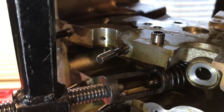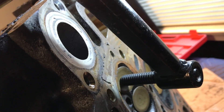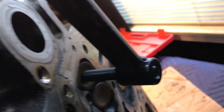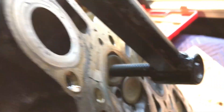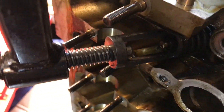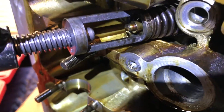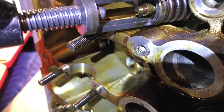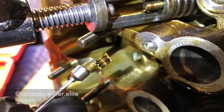You don't have to worry about trying to unload the spring so the keepers pop out. The bottom part centers perfectly in the middle of the valve so the valve stays seated properly — no risk of bending a valve or having it pop out and hit the table. The top part you crank in and once you release the spring the keepers pop out and all you need is a magnetic pickup tool to grab them.